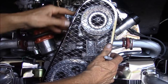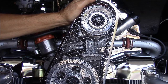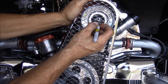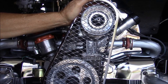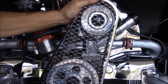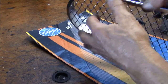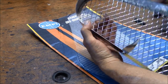What I do is get it exactly where you want it, because you can bend the brackets a little bit. Take a little Sharpie and mark where that nut is. This is going to be the trick part — the custom part. You made a mark on the outside of the belt guard; make the same mark on the inside of it so you know exactly where it is.